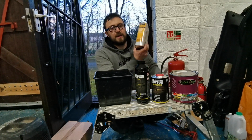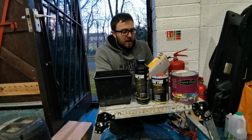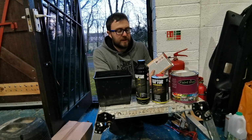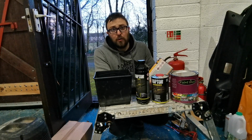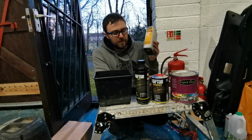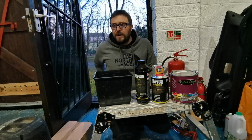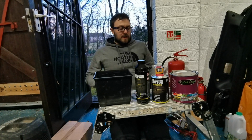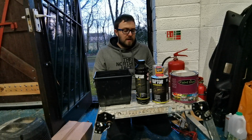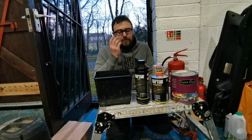So I've bought the U-POL urethane thinners in. I've gone with the fast drying, so they can do a fast drying, standard or slow. Again, because it's cold, I've gone with the fast drying thinners. And my thoughts are on the first coat, I'm going to do about 120 ml of thinner. So you can go up to 20%, but I'm going to stick to about 120 ml, just a bit under that, and just see what results I get.